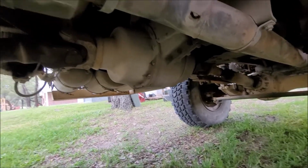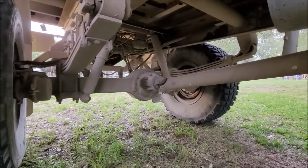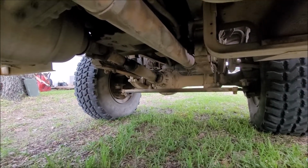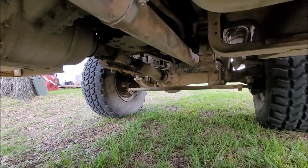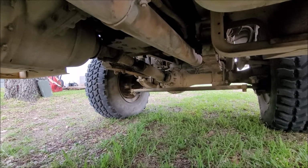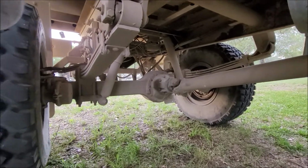It's actually more like an all-wheel drive truck, and it's split where most of the power is going to the rear wheels, and then there's a little bit going up front. And then when you press mode, that's sort of just like locking everything in to even power to the front and rear axles, so you get even better traction. So the truck never really goes into two-wheel drive, and a lot of the military vehicles like the Humvee are like that as well.